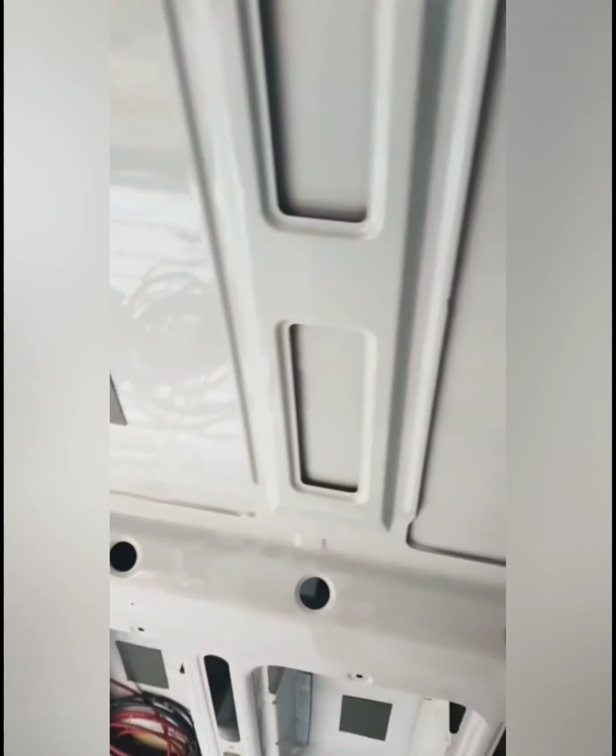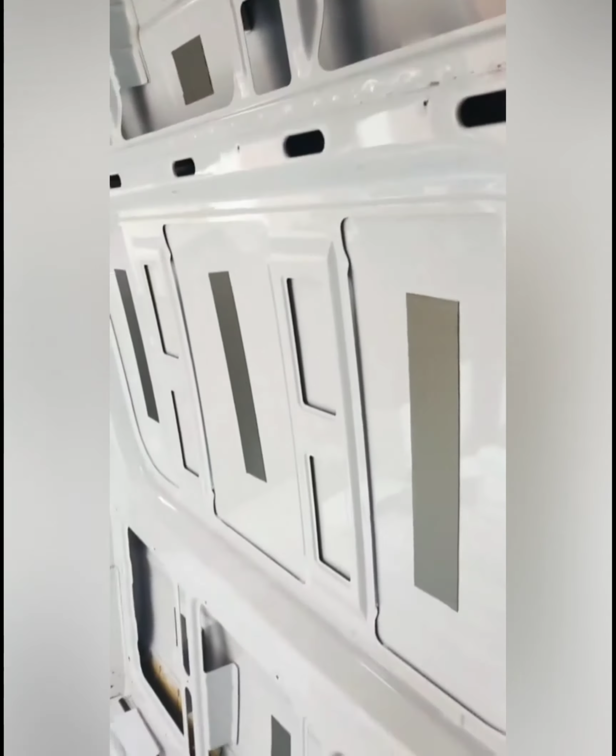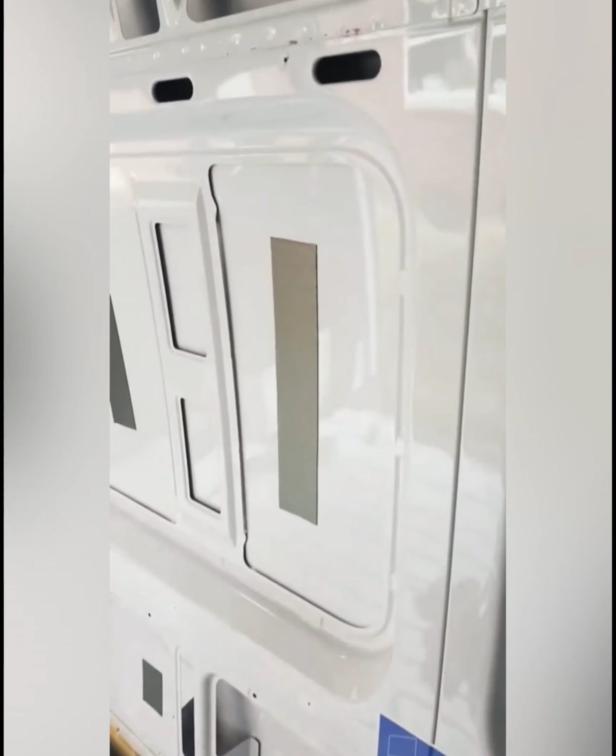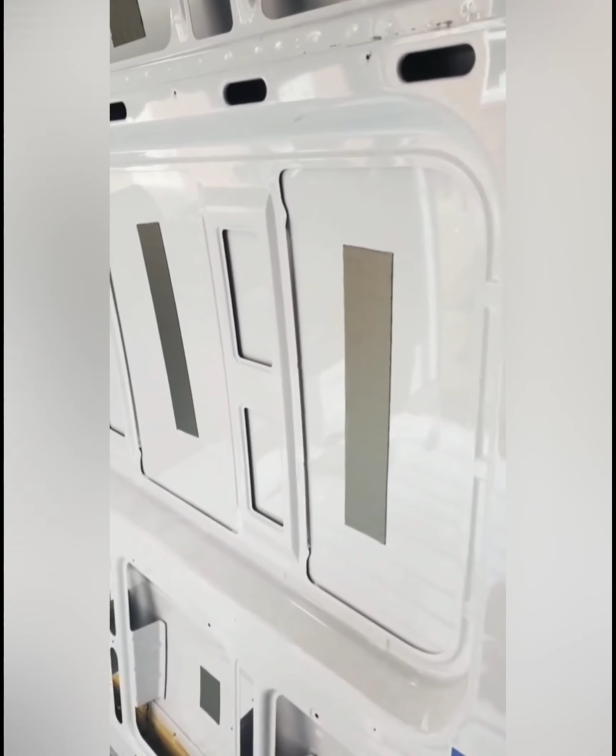But then these grooves need to be cut in a diagonal shape, because I don't know if you can see it, but they're not actually straight lined. So they're actually 2cm sunk in, the bottom's 6cm, and the sides are 3cm respectively. So now I'm just doing that. When the first one's done, I'll show you the end product, and then I'll show you how I'm going to fit it, which is a bit different than other people I've seen on the internet.